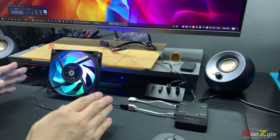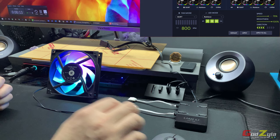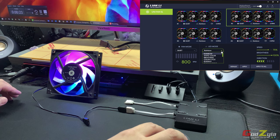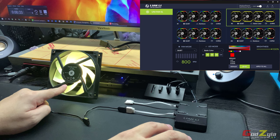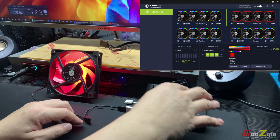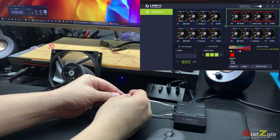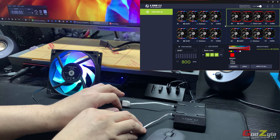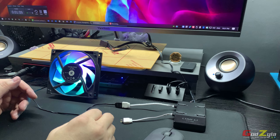I've connected the Unifan controller to my PC and it's lighting up. In L Connect I've set output one to rainbow and output two to static yellow — or red. The DIY converters I created work correctly. Unplugging and re-plugging confirms rainbow color on output one. That's how you crimp your own cables to connect to the Unifan controller. If you like the content, please subscribe and hit the notification bell. Take care, goodbye!